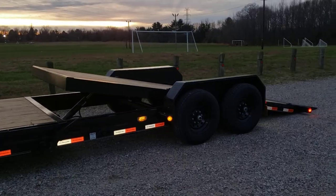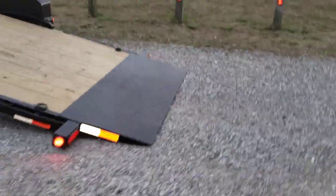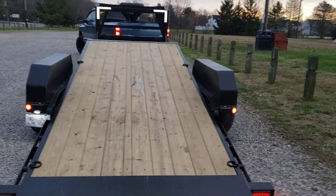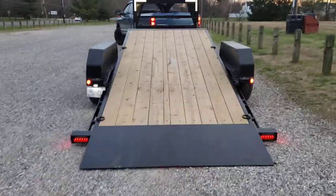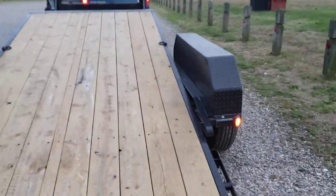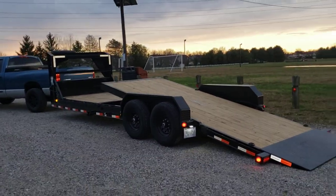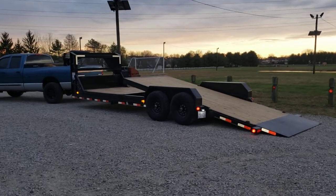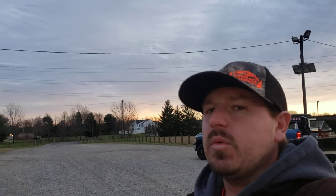Since just the last 17 feet of deck tilts, it's really awesome for loading cars and equipment — it's a nice low load angle with a knife edge in the back. This one has 82 inches between the fenders, so most cars and trucks can load right on there. For anything wider, you can remove the fenders — just a couple of bolts on each side, unplug your fender lights — and drive right over the trailer tires. I basically couldn't decide between hauling cars or hauling freight. I see a lot of partials on the load boards, but I'm also a big car guy. When you're hauling cars, you're in control of the load and unload — you're never waiting for a shipper or receiver.